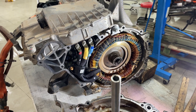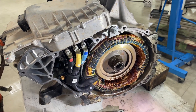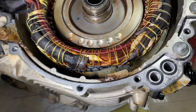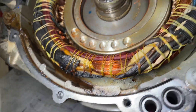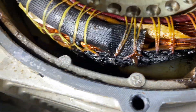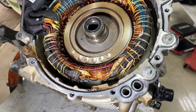This drive unit should be recalled immediately on all Vitos and Mercedes vehicles that use the same ZF unit. We found a second issue: on the stator side, one phase or one part of the phase is completely melted.